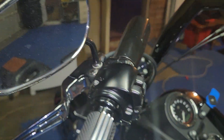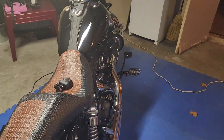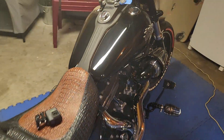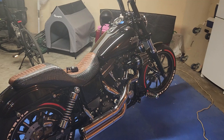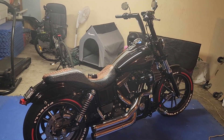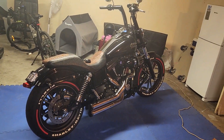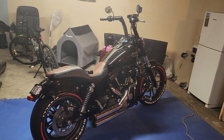If not, you want to take that housing off. Once it comes off you can actually clean everything inside there and it should be fine — very simple, nothing too complicated. I thought it was gonna be worse. So give that a go — stage one. If the bike does not start while it's in gear and only starts in neutral, that was the situation I had. Quick video, that's all you need.